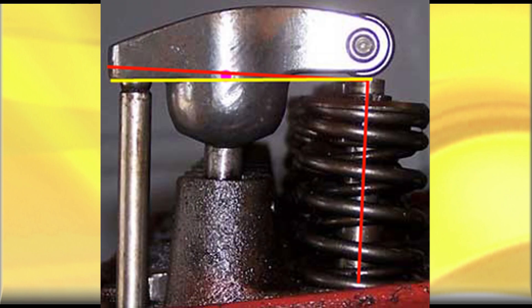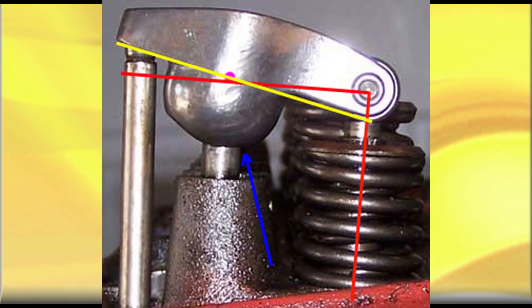Now let's fit a 186 pushrod with a length of 9.136 of an inch — that's 120 thou longer than the standard rod. Straight away you can see it almost looks like it is already at half lift. The fulcrum point of the rocker is now much higher and is in line with the tip of the valve instead of the collets, as in the previous photos. Check it out at full lift: note the angle of the rocker and the roller position on the valve tip. A blue mark taken here would look something like this. Also note the clearance in the rocker belly to the stud where the blue line is pointing — there is almost no clearance here. If that was to jam in there, you would break a rocker, bend a pushrod, or put it through the pushrod socket of the rocker.